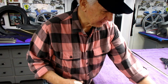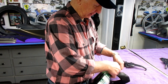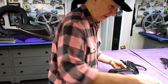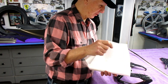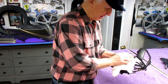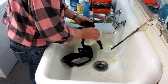There are a lot of ways to prime and prepare parts - Bulldog adhesion promoter and all kinds of systems. I like to use the old-fashioned system: primer sealer, clean the part well, sand with 400 - kind of old school, but it's the devil I know. These parts definitely have plenty of road grime on them, so step one is getting them as clean as I possibly can.